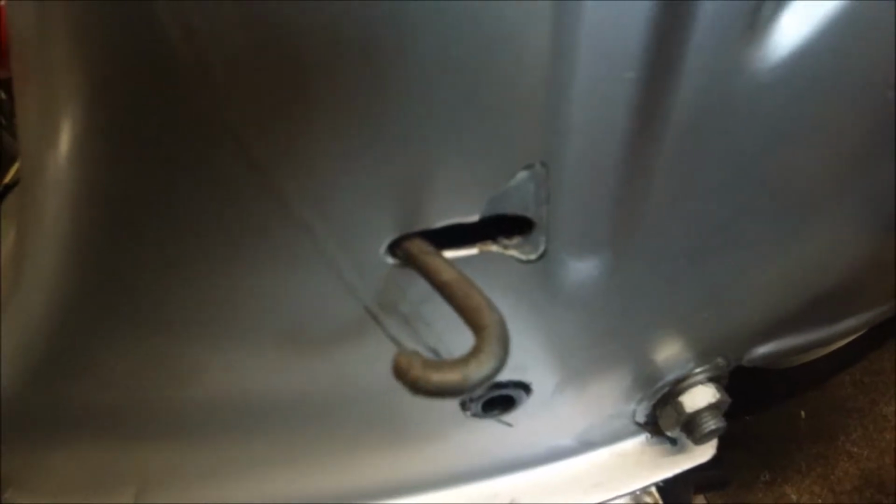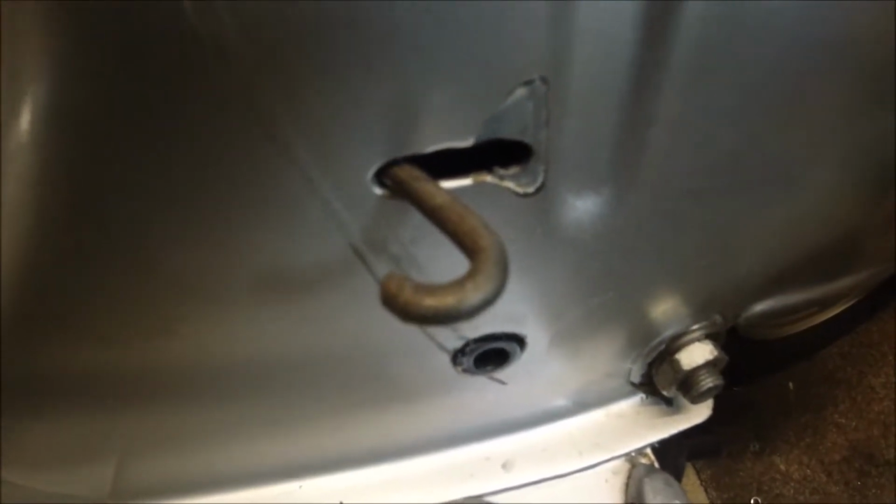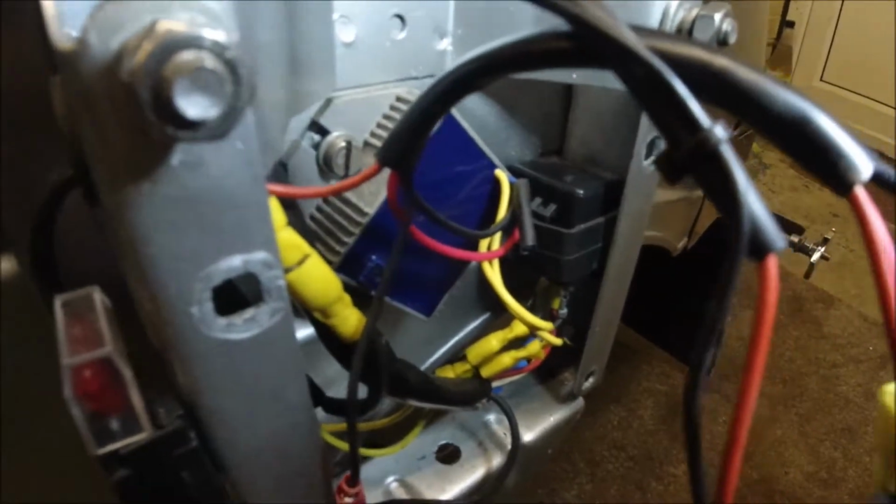They're your battery terminals, live and neutral, and that's the other indicator. And again, you do not earth from there. It's this beast here. That's what earths the indicators, I'm trying to say. So I'm going to stick the battery tray back on again. That gives you an idea of what you can achieve with these.